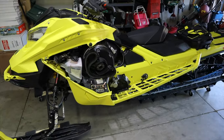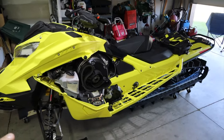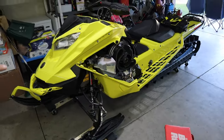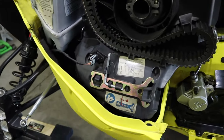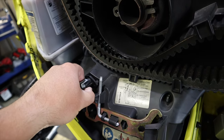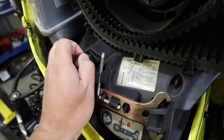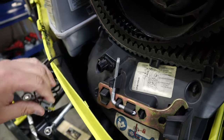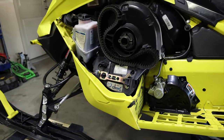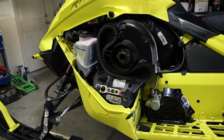Now as you can see right now, it's totally unwrapped. If you guys have been following my channel for a while, you know I just picked up this sled this year — this is my new baby. But we're going to go ahead and pull the clutch off now. I'm going to show you guys how easy it is. You will need a couple tools though. You're going to need first a clutch puller, and I will actually link down below the tool that we used to remove the clutch from this sled.